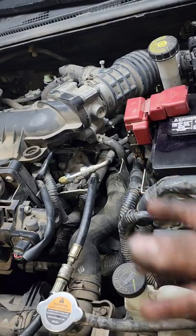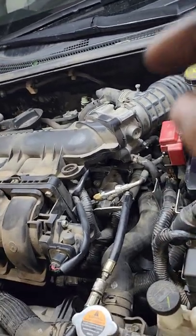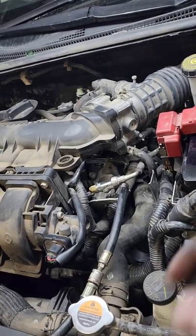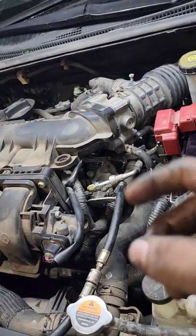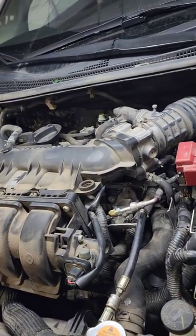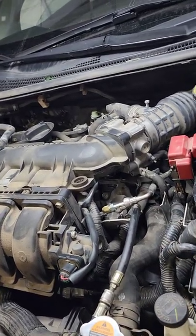Of course it's a gas, but if it's a liquid then it'll wet the spark plug and the spark plug will not fire. By cleaning out our injector, we're going to get a nice fine mist — like your shower head. Your shower head's supposed to spray right, and then you've got stuff going all directions. Let's make sure you're spraying a good atomized mist rather than all messed up.